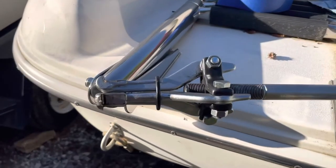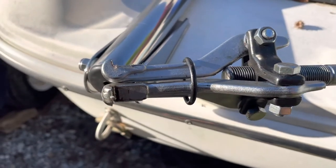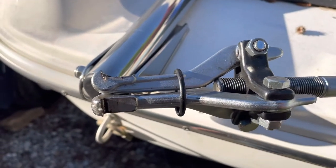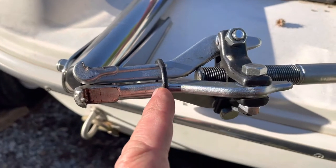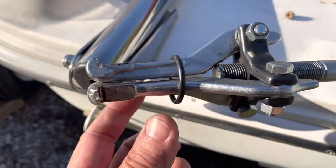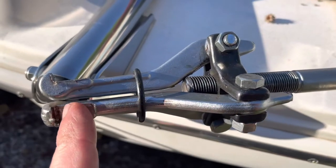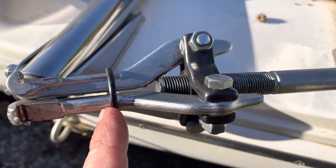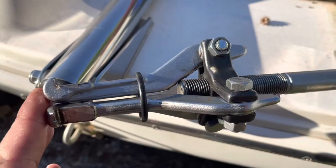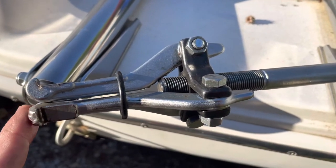Here's how I make the two work together. I take an old o-ring off the drive shaft of the Alpha One — you're going to get a new o-ring anyway with the new gasket set — so I take the old o-ring off the input drive shaft and put it right here. It acts as a keeper to keep these three jaws together; it's not tight but it keeps them from flopping around. Then you insert this into the gimbal bearing. There's a seal up in there so you can't go too far, but once it's in there you should be able to feel these hooks drop onto the inner side of the gimbal bearing.